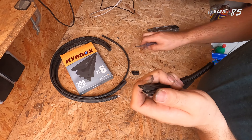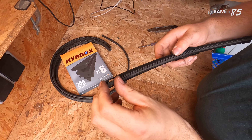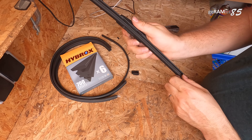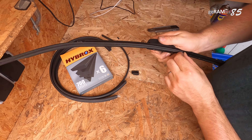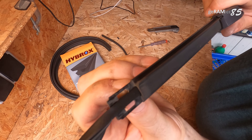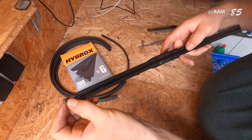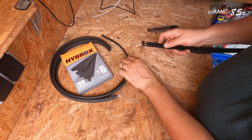Once those little hooks snap out, you can slide the cap off. Then start sliding off the old rubber from the back — it easily slides off. Keep the two metal rails apart from each other so you'll be able to slide the new one in.